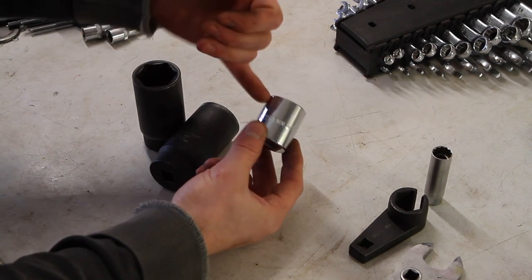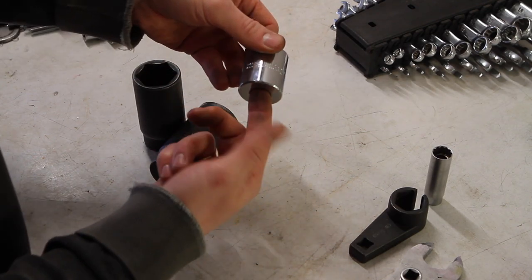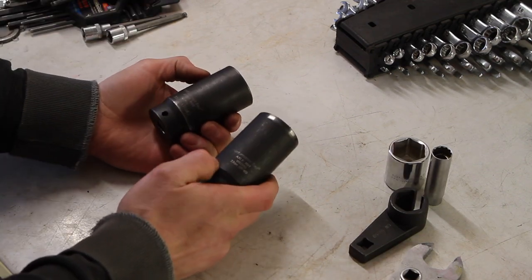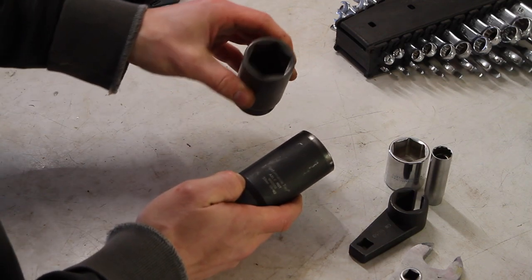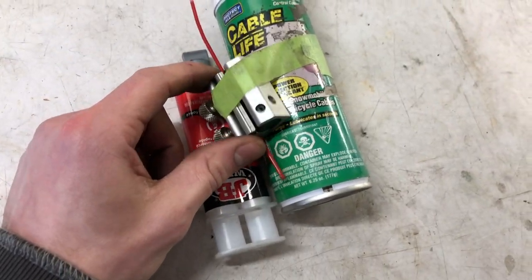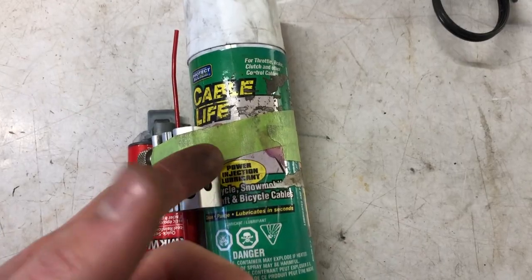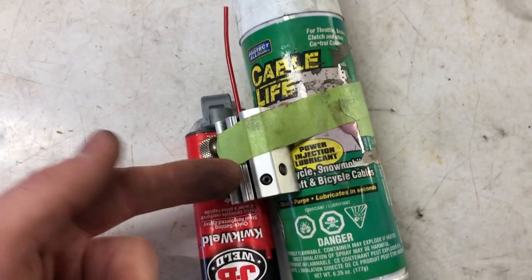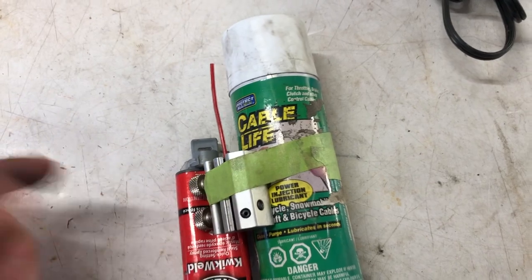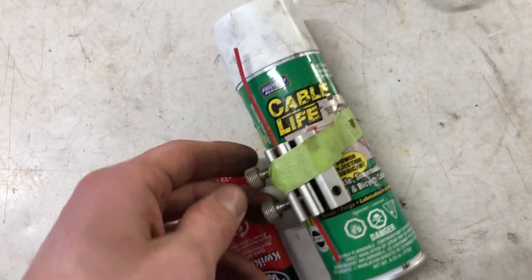This is an FZ6-specific tool — a 27mm 3/8 drive socket. Very obscure and hard to find in the 3/8 size, but this is what you need to remove your swing arm pivot bolt. For removing CV axles or similar jobs, I've got a 32mm 6-point and a 33mm 6-point. And this is kind of more of a product than a tool, but the product comes with a useful tool — a cable luber. I used it in my video about four tips for max reliability. It's a tool to help inject light oil into your cable housing, blocking off one end while you push lube through a straw into the housing. It works for some; it doesn't really work for me, but I'm glad I have it.